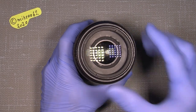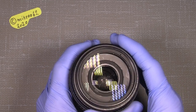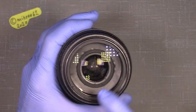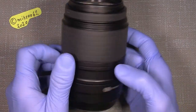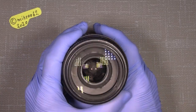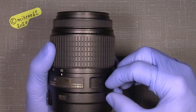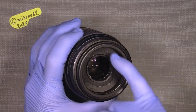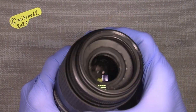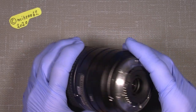So how to get into that? I mean, I missed the nameplate. Well, you can see somebody else has been trying to go in and actually unscrew the next lens group, but couldn't. And I can see there are also some marks here. Well, I have been into the lens and taken a sneak peek inside, and we have to disassemble a lot to go in, especially to the back here and the middle with the VR lens section, and also from the front here, as we can see in here. The moving element in here, we have to go in, and then we simply need to disassemble the whole lens.